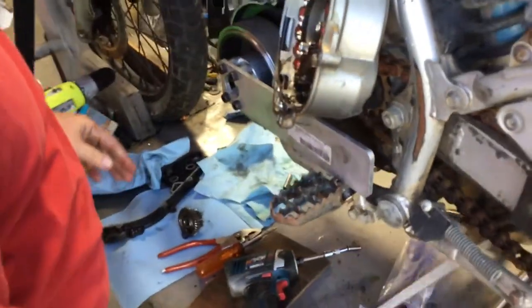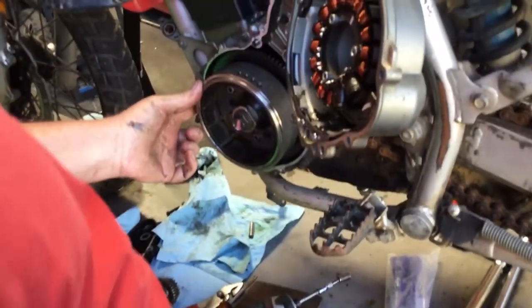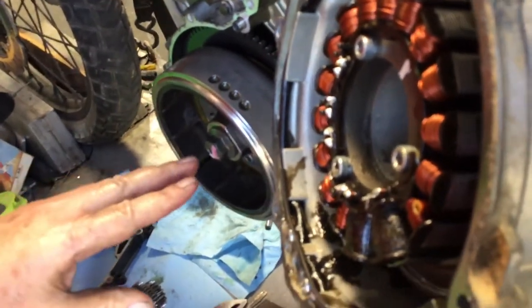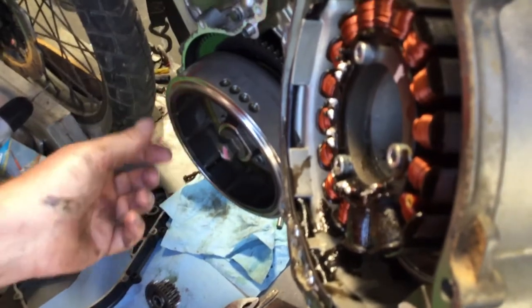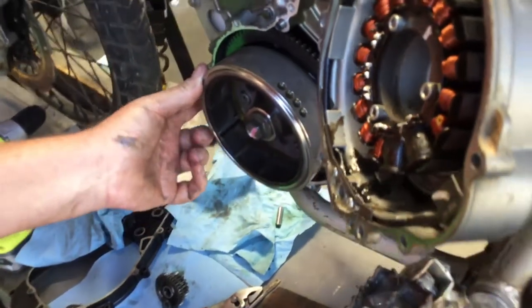I forgot to break it loose in between. Okay. I did make sure that this spun free the first time, but one thing you can do after the 85 foot-pound torque is break the bolt loose and then go to 135 or 130 or 144, okay? So this works.